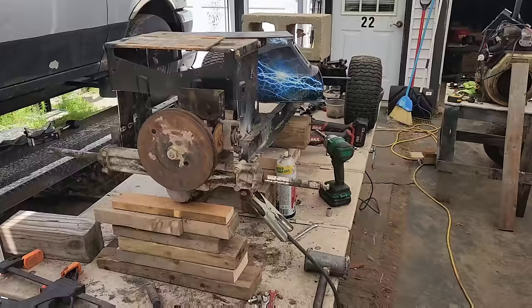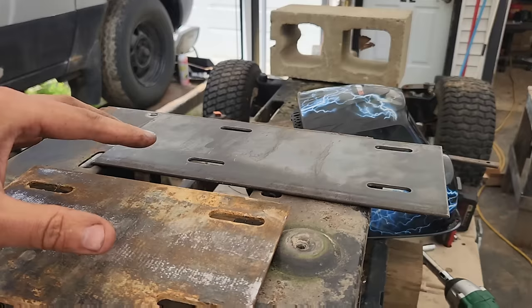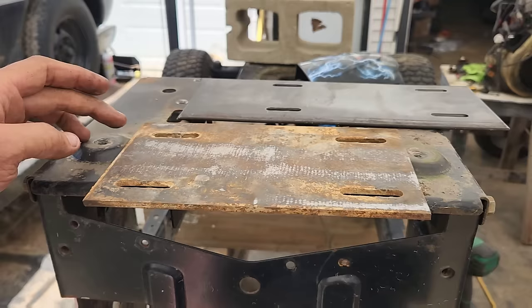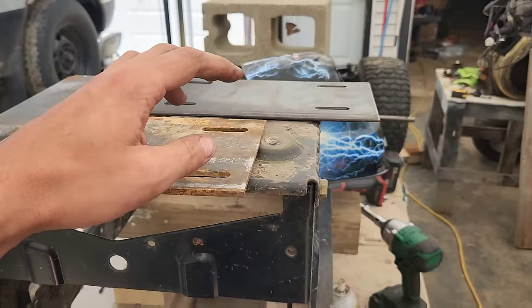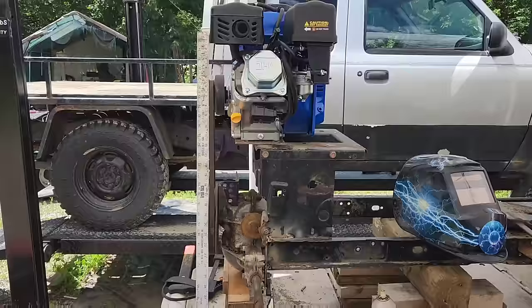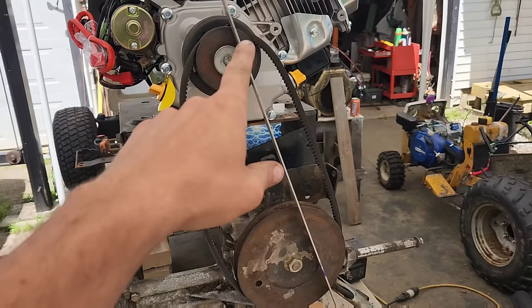I actually bought this longer plate for this project, but it's some knockoff brand - Azuku something or other - and I'm going to end up using this old-school OMB Warehouse plate instead. This thing is just bulletproof thick, and I think if I score these with a grinder I can get that to sit right flat in between them and go underneath the sheet metal, so we minimize what we have to modify with the rear sheet metal. Just wanted to walk around where we've got it lined up - it's just kind of a balancing act up there. We've got about a 42-inch half-inch belt on here right now just for mocking it up.